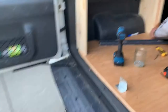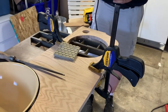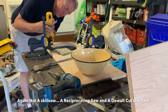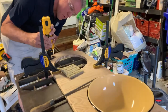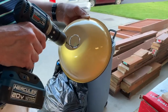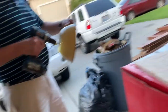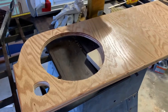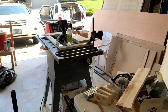As you can see, we used the cardboard to cut the initial curve, then traced it onto the wood to make it square. We knew we wanted to sink in the build, so the tabletop had to have a sinkhole — we used a skill saw and a router for that job. The little hole is for our freshwater pump, which I'll talk about more later. Cutting the hole in the bottom of the bowl from the white elephant sale was actually very hard because it turned out to be an aluminum bowl sealed with porcelain, making it more likely to crack. We also applied the wipe-on poly to the tabletop, which did a great job of sealing everything.